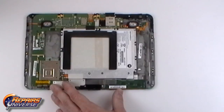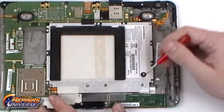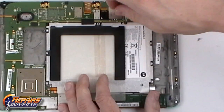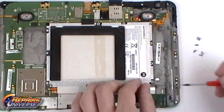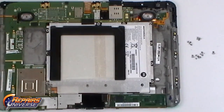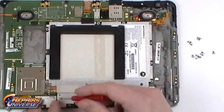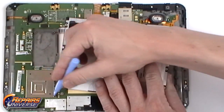With the board exposed, our next step will be to remove the battery. Using a Torx T6 screwdriver, remove the twelve screws as shown in the video. There will also be two Torx T5 screws that will need to be removed. With all the screws removed, we can now gently lift up the battery, being careful as it is still connected by one wire connector which simply needs to be popped out of the socket.